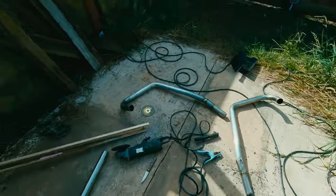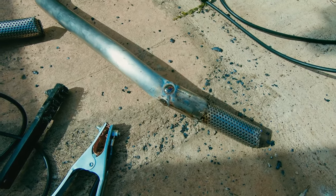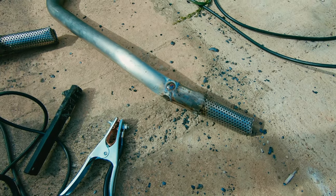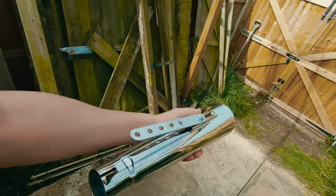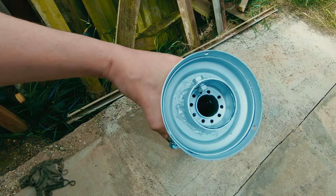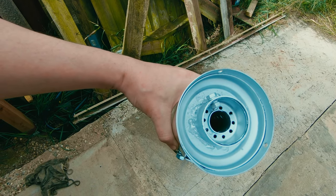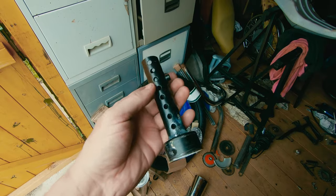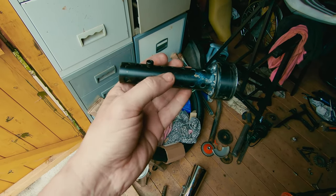So it will be not quiet, but much quieter. Because I was using this welder I had to fix the welds — it's terrible. But anyway, it will look good. Trust me on that. That's the muffler. What I did is the baffle insert, so I can make it quieter if I need to. I've prepared a standard baffle — 45 mils — and drilled a few holes in it.